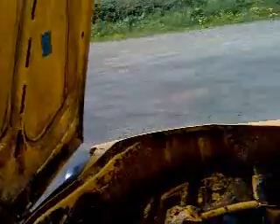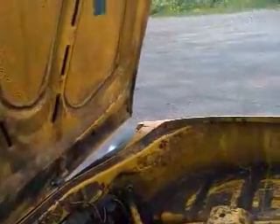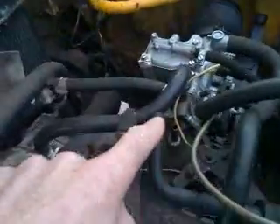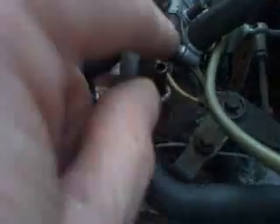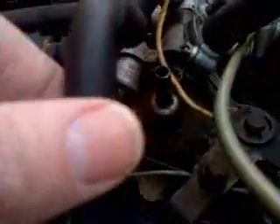I don't want to tempt Providence here, but I think I have worked out what the problem was. I took the spare wheel off a little while ago and I noticed that this pipe here was not on. Can you see a little pipe that goes from here onto a thing on the manifold? It's popped off.